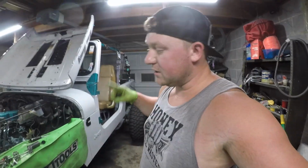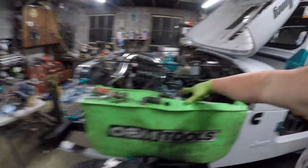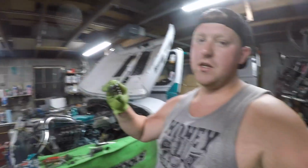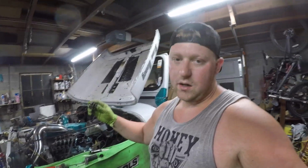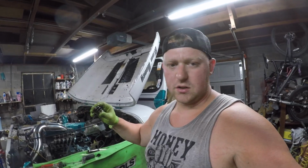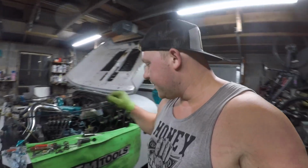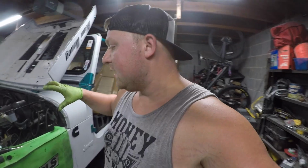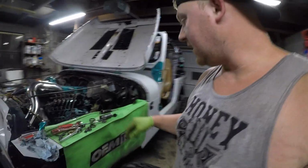Very important. So there's something else I want to mention real quick. Down in the bottom of that cup that holds everything in, there's an idle shim and a wear ring, or something like that. That is still down in there. I'm not gonna take it out. You do not wanna lose those inside there.